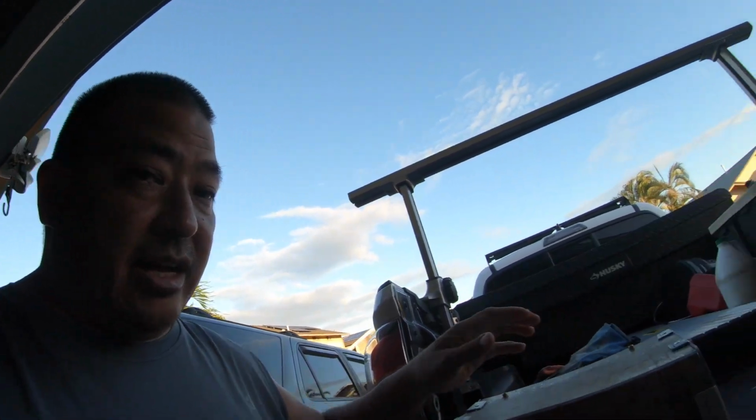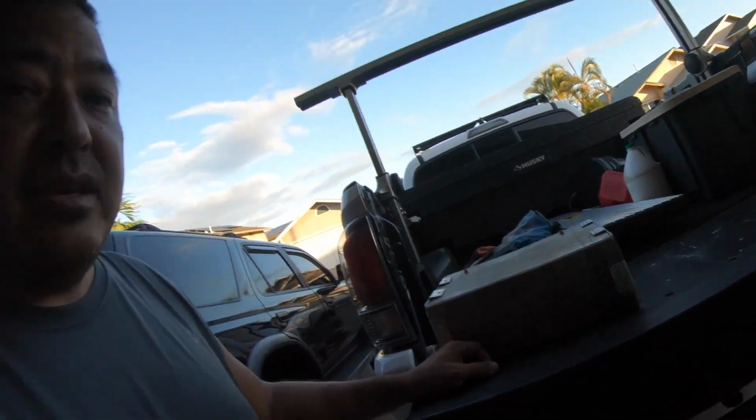All right, finally the next day, time to get this thing back in. Before I put it in, I forgot one last thing, besides the lens is dirty again. The last thing I need to do is just drill two or three, maybe 3/8 holes inside the bottom, and that's gonna allow this thing to drain properly if water, junk, mud, whatever gets inside. The stock one had two holes. I'm gonna put three and see what happens.